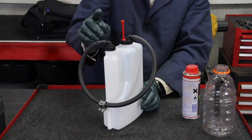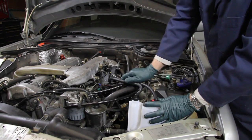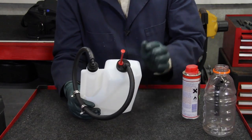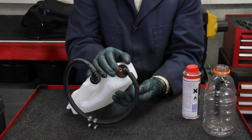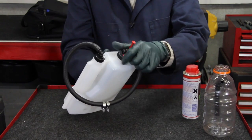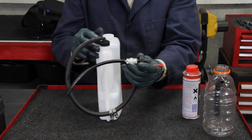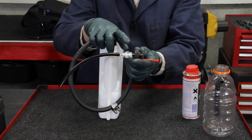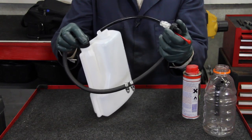So I made some refinements and came up with the final tank design. We were able to get 90-degree fittings coming out of the caps, which allowed me to close the hood with less restriction. We also needed a way to vent the tank when running fuel in it, and I decided it was necessary to have a filter inside the tank. On the pickup hose coming out of the bottom of the tank, we installed a very fine pre-filter to protect your injection pump.